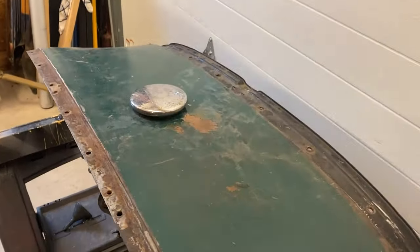The final stage in the process is sealing the tank. We opened the can of fuel tank sealer and stirred it up until it was a nice, uniform silver color. Once the sealer was ready, we closed up the gas gauge hole on the face of the tank with the cruddy old gas gauge, and we sealed the petcock hole on the bottom of the tank with a plug. Then we poured the entire can of sealer down the funnel and into the gas tank.